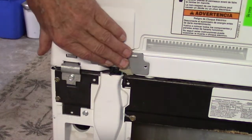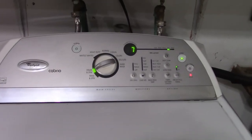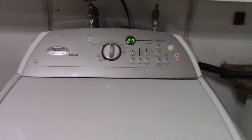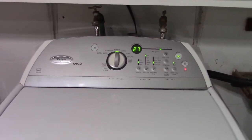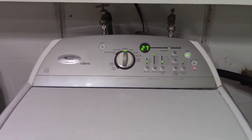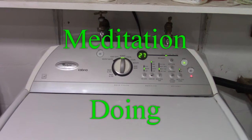Replace this cover — it protects the wires. Running it through the spin cycle. Now that looks like that did it. This machine would not spin the load — it was unbalanced, the drum would bang on the sides. The reason for that happening was worn-out springs on the suspension rods. So for a $50 repair kit for new suspension springs, it's a fairly easy repair job. Working like a new machine again. Thanks for watching my friends, bye bye.